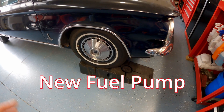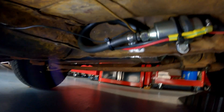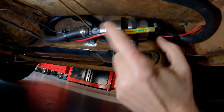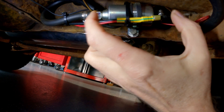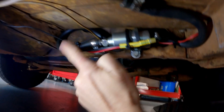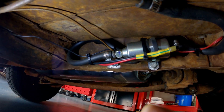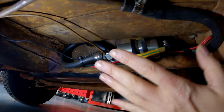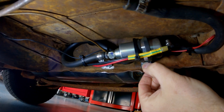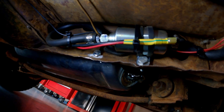I've jacked up the front of the car and put it on a ramp so we can get a better look underneath. This is the actual fuel pump — you can tell by its cylindrical shape that it's the motorized vane impeller type, not the square thumper type I've used in the past. It's super quiet. A line comes in from the tank, wraps around, hits the pump, comes out, and catches the hard line going into the belly pan into the back of the car. It has a ground wire and a power wire, and installs easily with its own rubber-mounted strap and a single bolt mount.